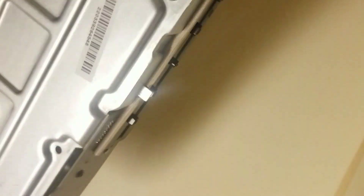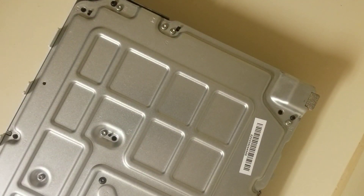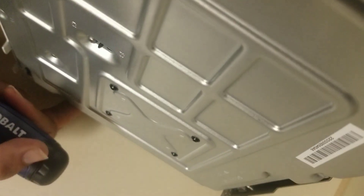Each component here has a set of screws underneath that go with it — like power supply, hard drive, fan. You always have to line it up. The disc drive is labeled O2 in here. The screws — it looks like the B screw and C screws go to this one. The screws in the bottom are also T10, so T10 will work on those as well. For this repair, we actually don't have to switch screwdrivers.